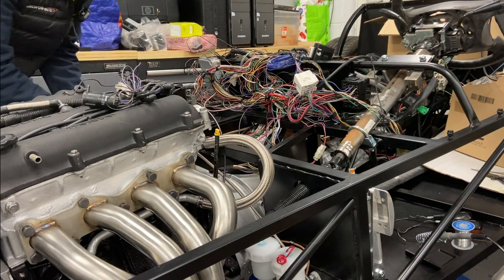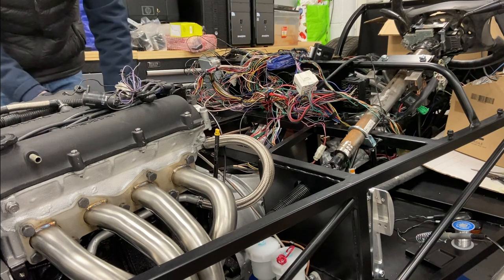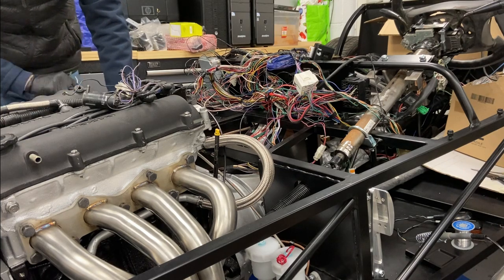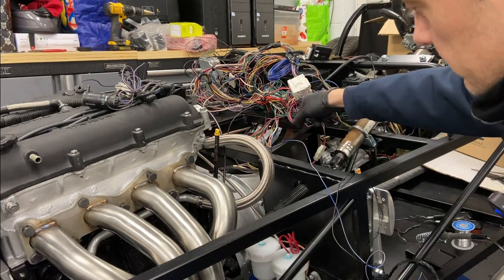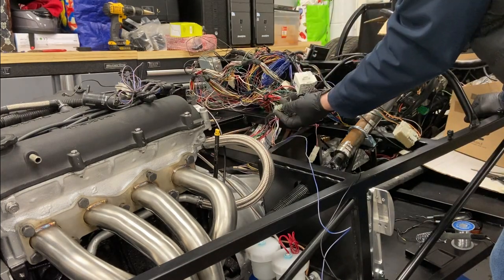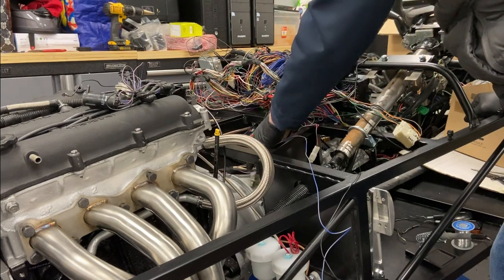All the dimensions of where to put the loom are in the manual. Here's what we've got: a white wire, a red wire, and a thick green wire — those are for that headlight over there, so I've got to extend them all the way around. I've also got to extend the brown which is the hooter. Because this is a left-hand drive car I'm going to run two looms. Down here there are two switches — one is a push-to-make, the other is a push-to-break.